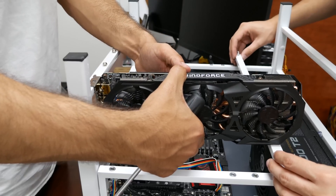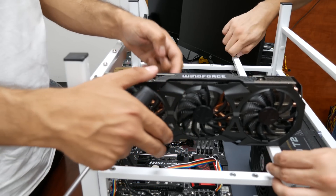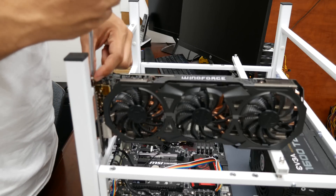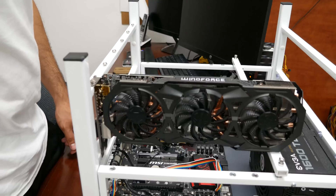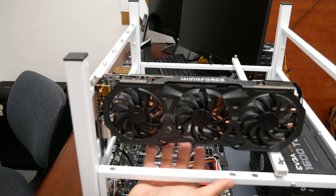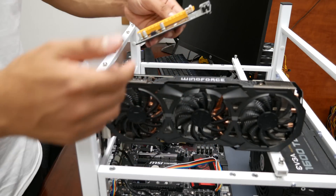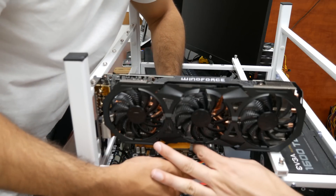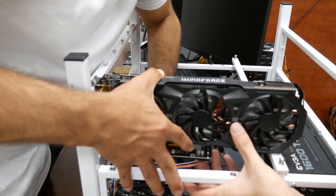Let me check the length of the card first. I need a hex screw. I'm gonna start screwing up this top half right here. At the bottom is the PCIe Express connection. The connection sits too high from the motherboard, so we're gonna take this riser extension piece and connect it to the bottom of the card so it'll extend down to the motherboard slot. You gotta slide it in — there we go, it's in. Lock it with the white locking piece.